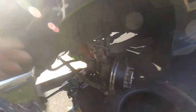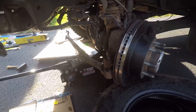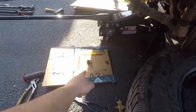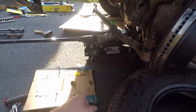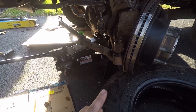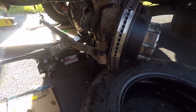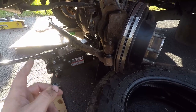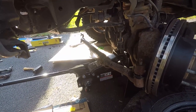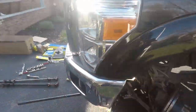I did end up having to take a tire off — at a certain point you're hurting yourself more than helping by trying to keep it on. I was being lazy. We got this guy off. There was so much rust and corrosion on this nut that as I took it off it smoked. They had some kind of cap on it for the cotter pin — that shouldn't be the original nut unless Ford does something different. Anytime I've done it it's just been a castle nut for the cotter pin. So I'm about to beat this out, but first I'm going to run and get a new tie rod adjuster sleeve because I'm having a heck of a time trying to get the old one out. It's probably best just to have all new stuff — this stuff is a disaster.